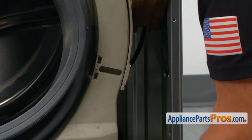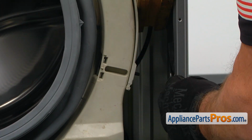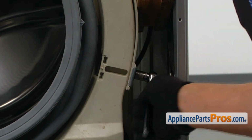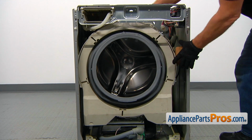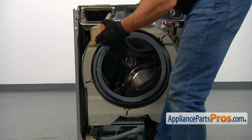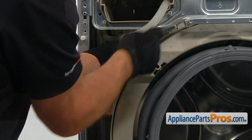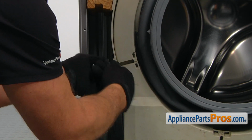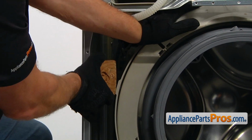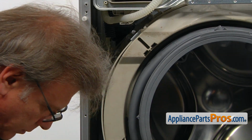And we can go to the second one. The bolt goes first. Then the bracket and the washer and the nut. Now we're going to switch the sides. I'm going to put the spacer on the opposite side. And secure the counterweight on the left. Now we can remove the spacer. And we can go to the bottom bolt.